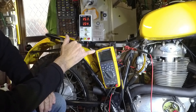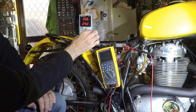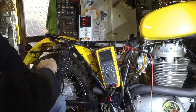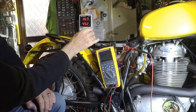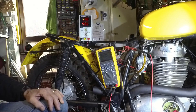We're up to 14.7. This is a 10 amp power supply, so it's winding up a bit. It's still going up but it's flattening pretty much — it'll be some sort of asymptotic curve — the breakdown of the Zener diode. We're up to 15.6 volts at 5 amps, so that's 60 watts. The Zener should be getting pretty warm now.